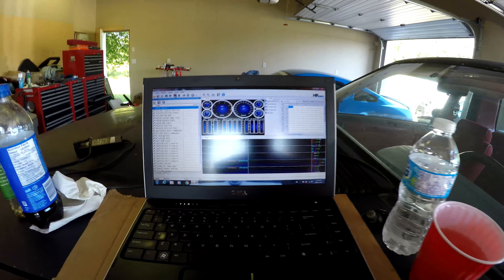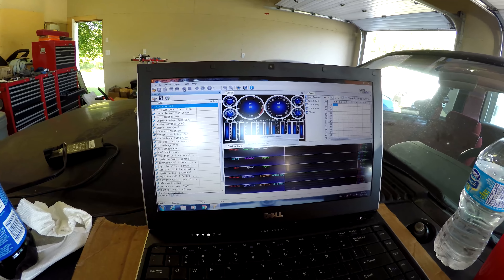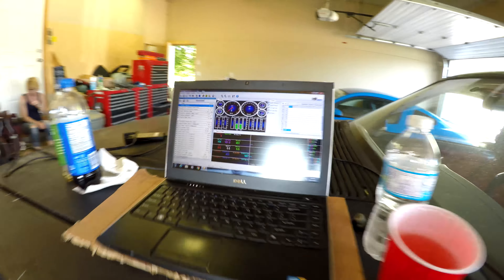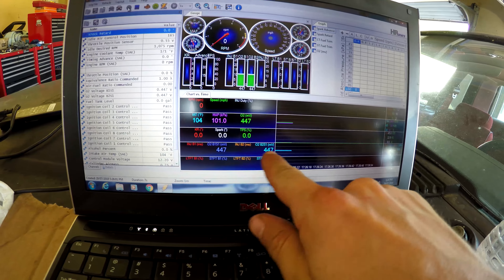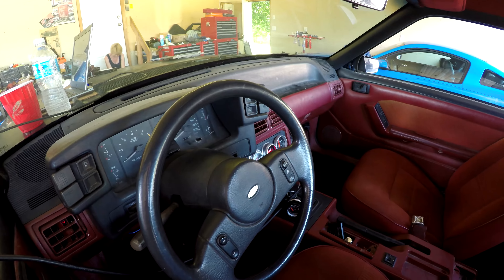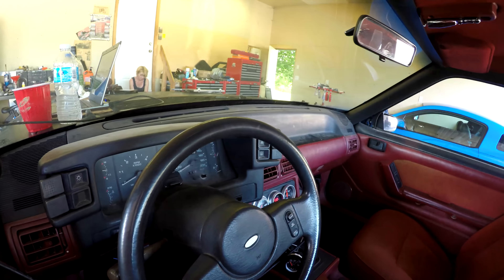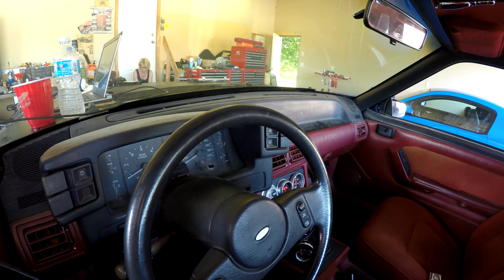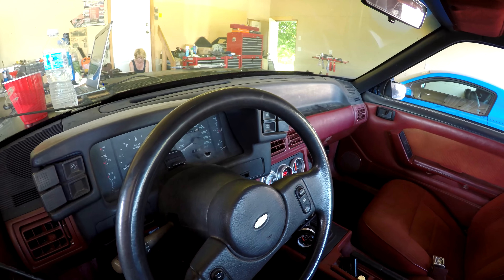So now that we have the oil leak fixed, we're trying to do some tuning and get this thing idling a little better. We're in the scanner right now, just hit record, it's connecting. So we're connected and you can see it's recording stuff already. The air fuel at idle when we started was around 11, 11 and a half. I took some away and it got to about 12, high 11s. Now it looks like we're around 13. Basically all I'm doing is taking away fuel from the VE table. I multiplied it by 0.85, so I took away 15% from the entire table. That table was set up for the 6-liter that used to be in here, so it's going to need some volumetric efficiency removed, obviously.